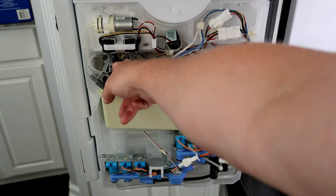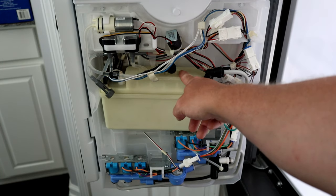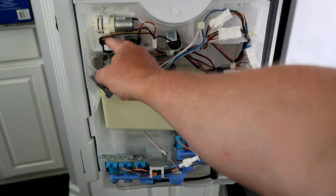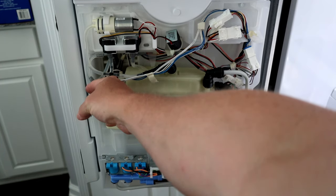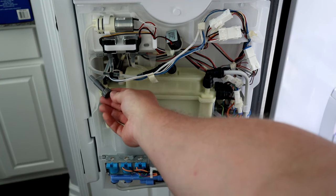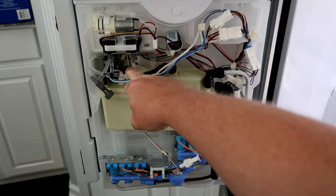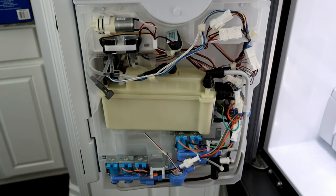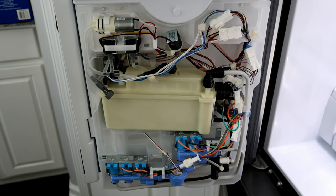The water exits back here in the back. As the cold water comes in the bottom, the hot water moves up. This tank up here is pressurized — there's an air pump here and a couple of control valves that pressurize the top of the tank. There's also a pressure relief nozzle that controls pressure relief, so if it gets too much it can blow off — I think it's around 20 psi. The air pump is used for a couple of different things: it blows the rest of the coffee and hot water out of the tank at the end of the brewing process, and probably for some vacuum purposes too.